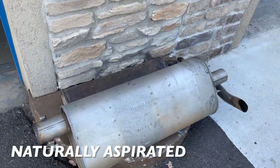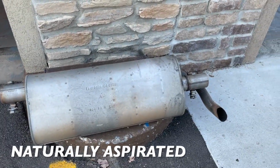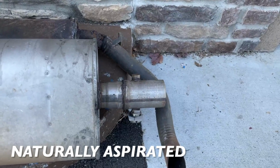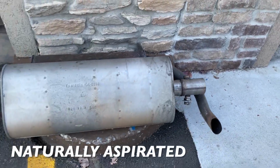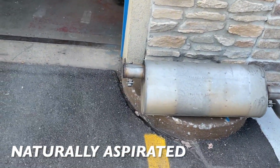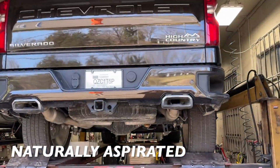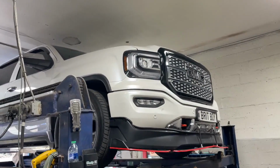There's the gigantic muffler that was on it, as you guys can see, and it comes with that valve. Anytime you have the muffler shop cut it off, make sure they cut off this valve or it will rattle. So make sure you cut that on both sides. There it is after. We'll let you guys hear it in a second. Hope you guys like it, and there'll be a link in the description.